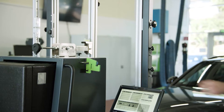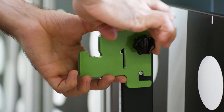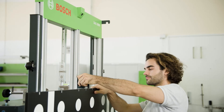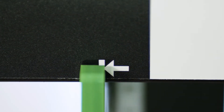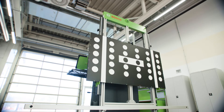As described in the setup information for the Audi A4, fit the two adapters marked 1 in position A and mount the dual-board calibration target. Center the target precisely after initial mounting. The dual-board can be mounted at various heights and thus covers all vehicle types of the Volkswagen Group, including large vans.